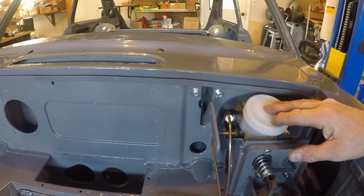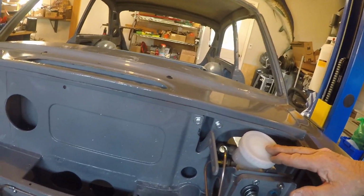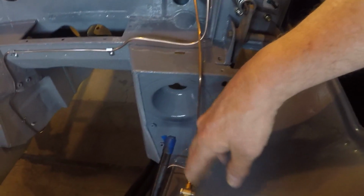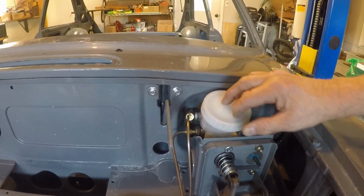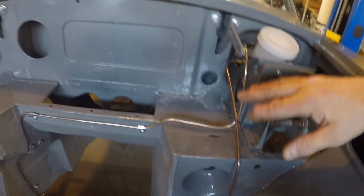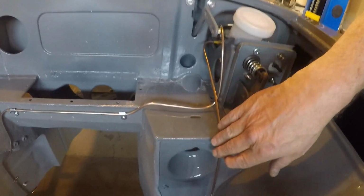The brake system has been upgraded to a dual line system, so there's the front and the back. Up through '67, the MGBs had a single line system, where just one line came down to a four-way down here to separate the front from the back. '68 through '74, I believe, used this master cylinder. There's a rear and a front, so it's a much safer system. It is not like the stock system though, because I did have to custom length all of these brake lines.